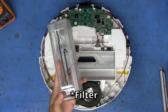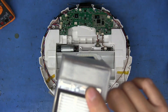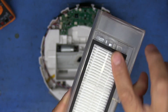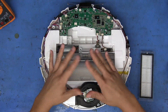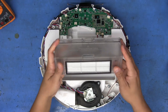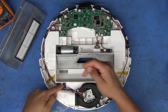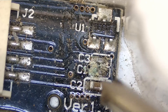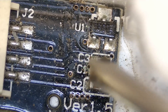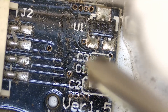If it did not have the dustbin installed, that would make sense. The way this detects whether or not there is a dustbin installed is by using that small square magnet that's actually attached to the filter assembly. So if there's no filter installed and you install the dustbin back into the robot, it would still tell you there's no dustbin installed. That magnet interacts with a small board right behind this wall. And I believe I have found the problem — getting in real close, we can see what looks like corrosion right above where these two capacitors are, labeled C3 and C1. There's also a via right in between the three and the one.